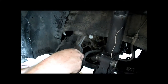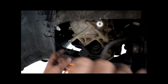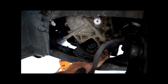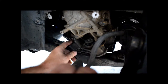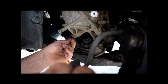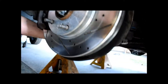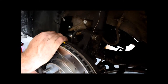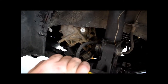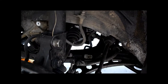We just removed the dust cover here — just two bolts, 10 millimeter. That removes the dust cover. Here's the transmission mount; they give you a tranny mount in the four-mount kit. We're going to leave this bolted up for now. There are two bolts on the engine side, and then under here there are two plastic plugs you pull out from the frame — two bolts underneath those. The majority of this car is 10, 12, 14, and 17 millimeter.